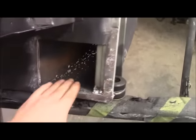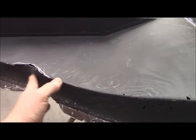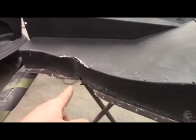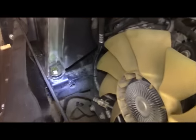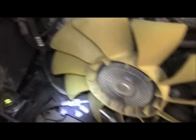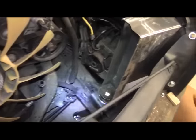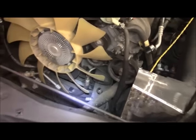I've still got some plate work to do inside of here. You can see how the bottom is all heated up - I'll probably do an overlay over that once I figure out exactly where I need to go for the upper control arm right there. Now I want to show you how these front strut bars are looking. You can see that one's going to look factory - by the time I get all that painted black and dress it all up, I'm going to do a little different work on those washers and mounts. That's going to look completely factory. I widened it up so I can get my other radiator in there, and now I'm fixing to work on that cross tie bar.